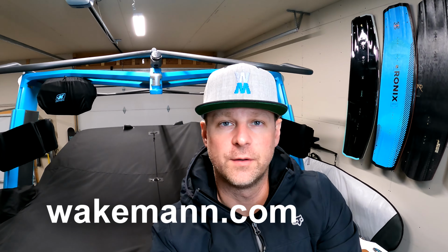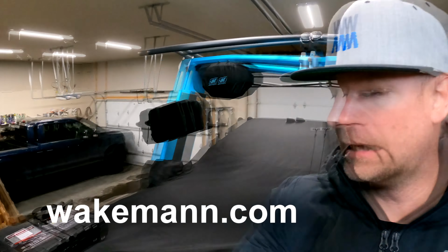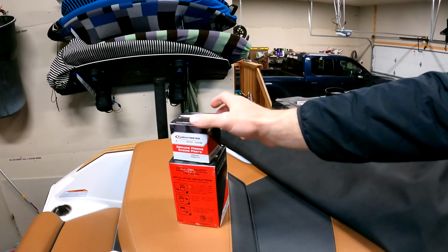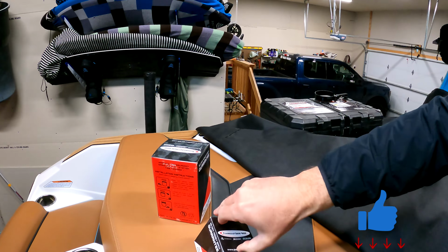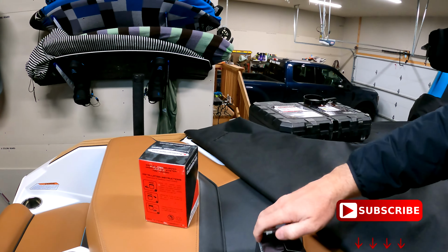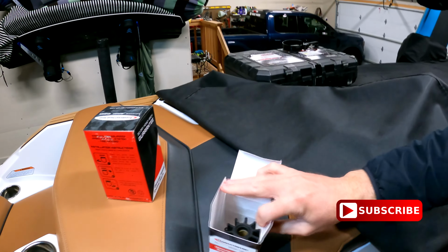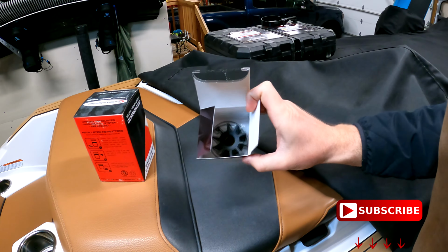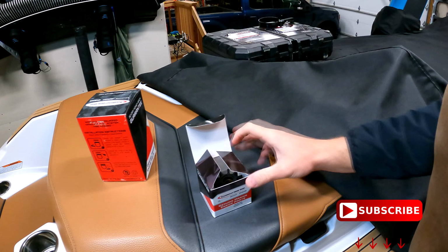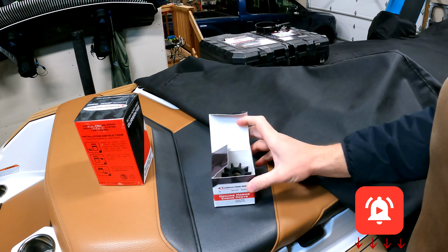Alright, so it's been a little bit since I've done a video. I think it's been about a month. In this video, I'm gonna do a few things to my boat. Right here, I've got a new impeller. I'll open this up. You're supposed to do this every 100 hours or every year. And I did this last year, so I know exactly how to do this.